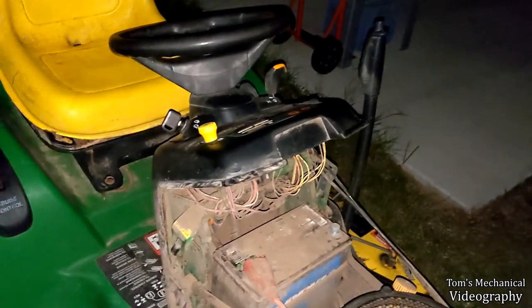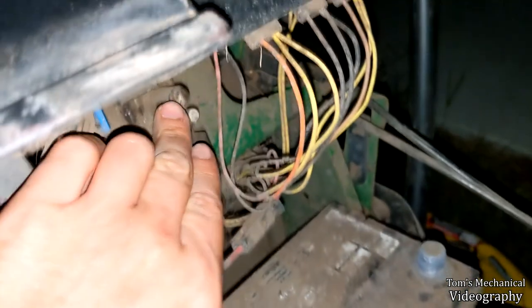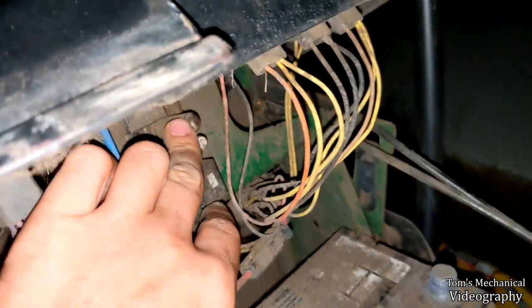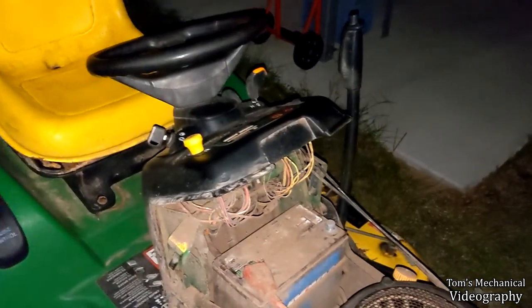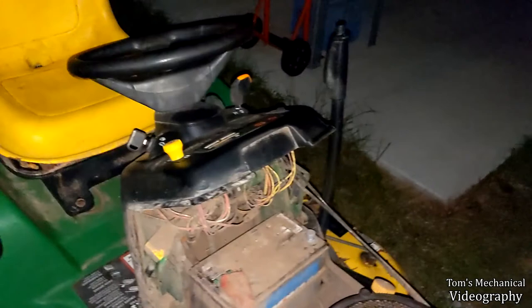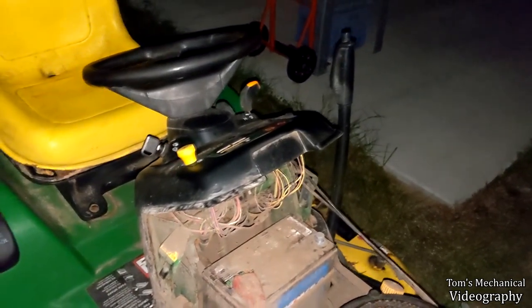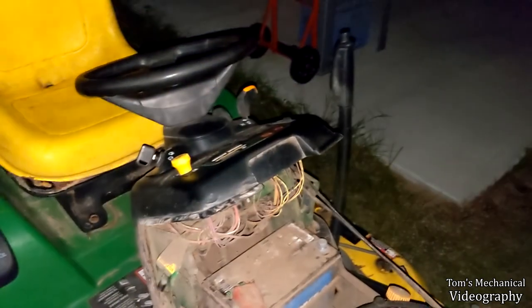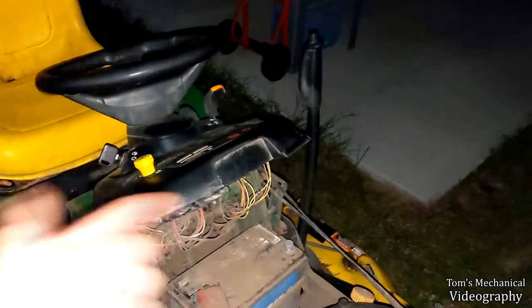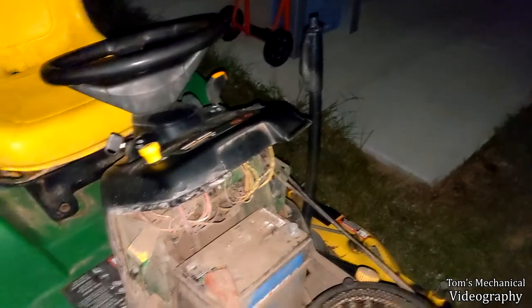I think I'm going to use one for about $80, but my thought is to just pull this all out of here and see if I can replace this capacitor that let all the smoke out. I'm hoping that should just be a fairly simple fix and shouldn't explode again after that. And if it does, I probably would have bought a 5-pack of those, and we can try it again. And if it still fails, then we know something else burned out, and the capacitor shooting smoke out was just a symptom of something else shorting.